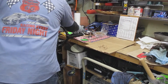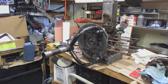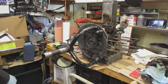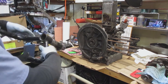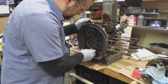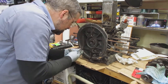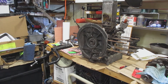Now I'm going to remove the short block from the engine stand, prepping to do the end play adjustments. A couple of things you'll need are some shims — you use three different shims for installing the flywheel, making sure there's assembly lube between all shims. I'm also cleaning up the case before I put the flywheel on, and cleaning up the area where the oil seal goes on the front of the engine, scraping off any permatex that oozed out when the two halves were installed.